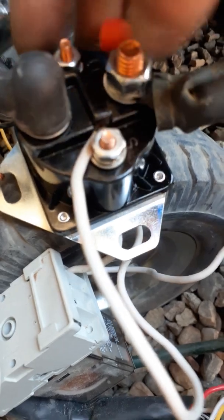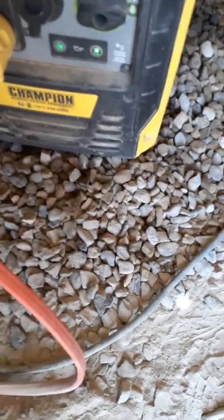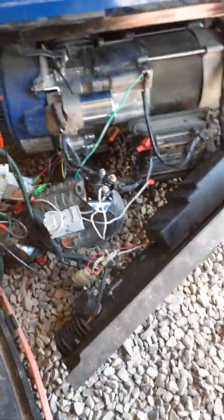I don't have this one wired in because it's continued through this circuit over here, but remember the white wire you see here is where the black and white striped wire from your generator will hook in. So that's it. Turn the key on — or in my case I have it wired into this small starter generator that starts the bigger generators for irrigation. As soon as I plug this one in, you'll see the bigger one turn on. Ready — three, two, one. And that's it — sorry for the backfire, that was loud.